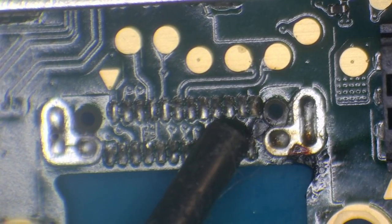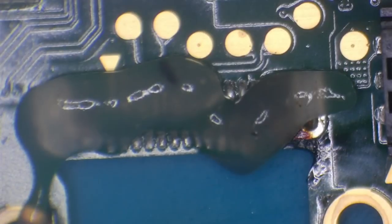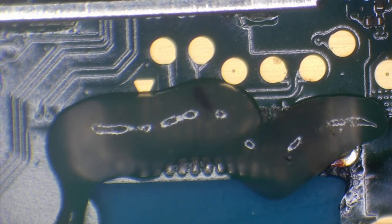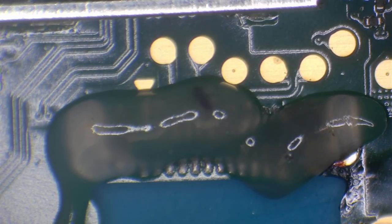The first thing I want to do is add some flux to help the solder flow. I'm going to add some flux and add some to the bottom legs as well, and then replace the solder that's on here with some leaded solder. I'll say something now because I've been getting a few comments about it lately — people questioning the fact that I don't wick away the pads. I will never be seen wicking the pads on a Nintendo Switch — not the ones that are on the port itself. The ground legs are fine, but the ones on the ports themselves are very, very weak and not designed to be wicked. By wicking, we can lift the traces off the board, and then we've got to deal with 0.3mm trace repair, which is certainly not a fun job.